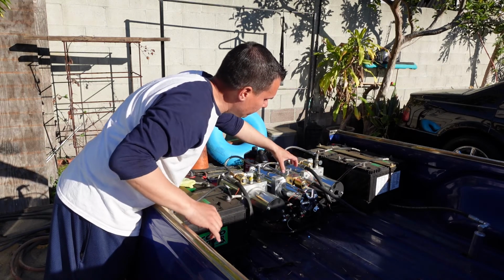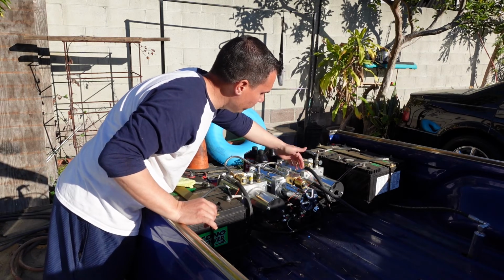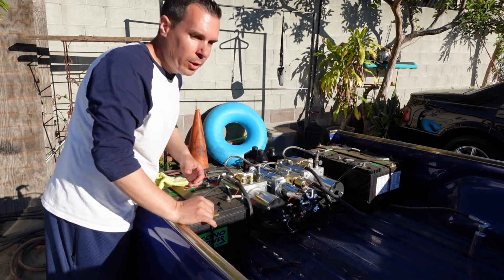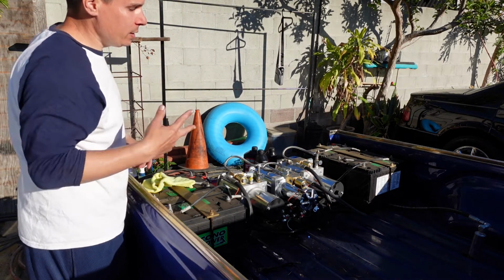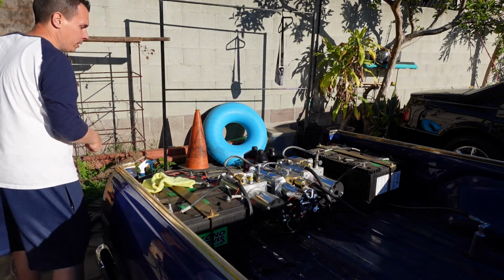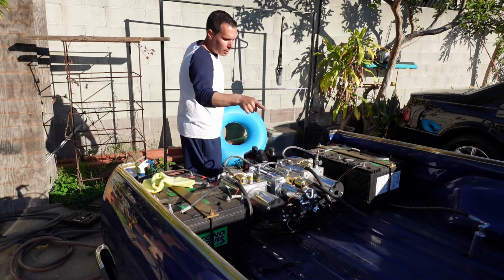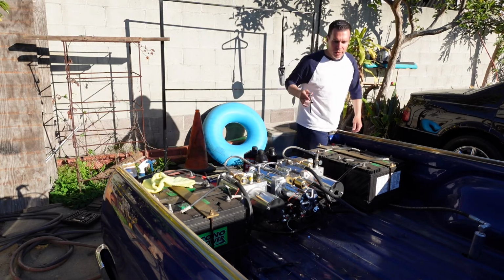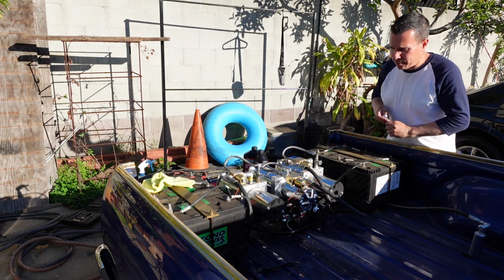Or even if you just have to service the dump itself or check valve, you can unbolt those and just unplug that and take that off and work on that workbench. Makes it nice and easy instead of having to cut something and re-crimp it every time. You can just unplug it, plug it back in. Right now, let's just connect up the motor and then fill the tank with oil and test out the system.